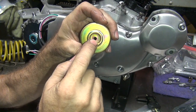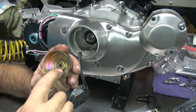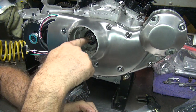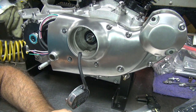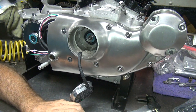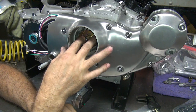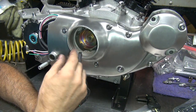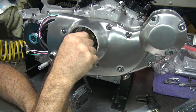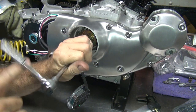So when you tighten this down, this here is going 20 thou more. And that's causing a stress fracture, and they're fracturing down inside the radius is where they're breaking easily. I've had a couple break on the top, but easy to break on the inside. Not sure why they're doing that. So if you put a little washer in there, it might hold this up enough to keep it off the edge. Problem is most washers are more than 20 thou. It'd be a pretty thin washer. So you have to figure out how you're going to make that fly. The other problem is that notch gets kind of in the way a little bit too. Now if you space it off the cam just on that little snout, then this whole thing might flex and break on the outside edge. So it's kind of a toss-up where to do it. So I don't know what to do on these things. We're playing around with these things, and I don't have a common fix yet that seems to work on everybody. But they are breaking.